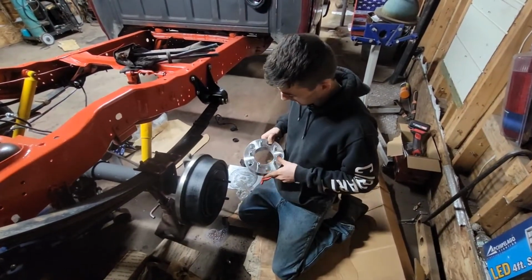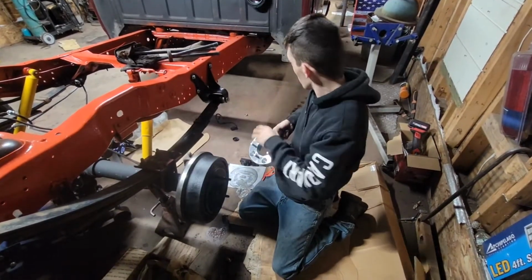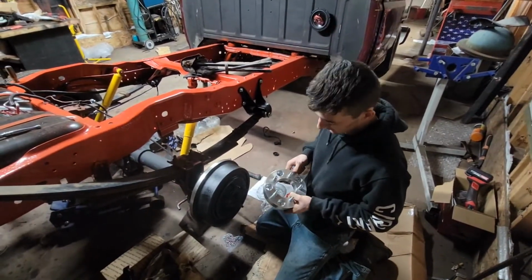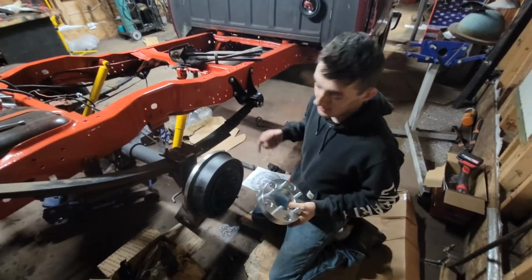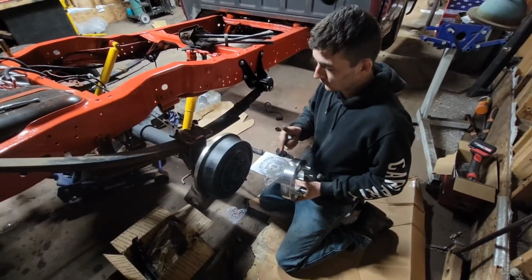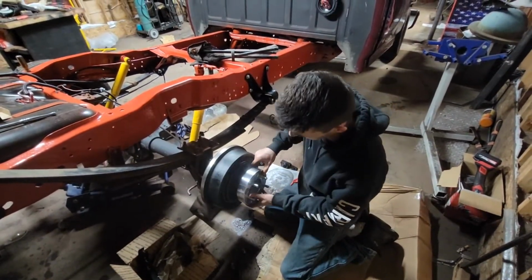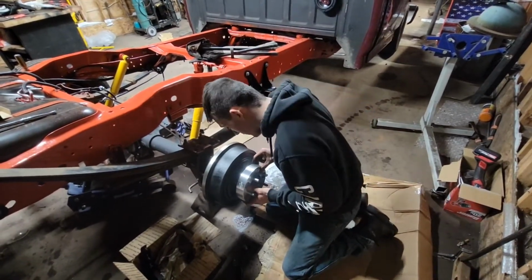Yes, Crown Vic wheel pattern, so we can drop on all the wheels and have a great selection of wheels out there, because you're limited with the 5x5.5 pattern. It gives us that nice spacing, because we're gonna need spacers anyways as the wheels sit in a little further. So this was kind of a two-in-one job for us. And then we go with a nice, cool, deep dish wheel. Exactly. Here they pop right on.